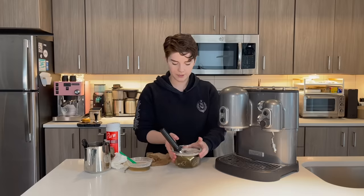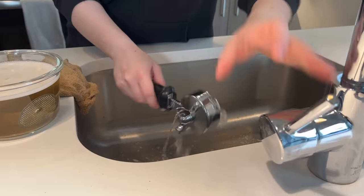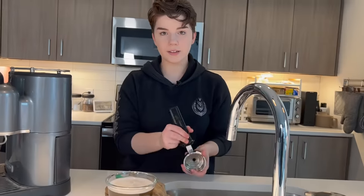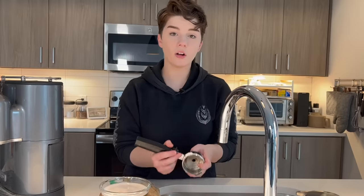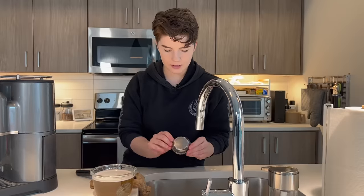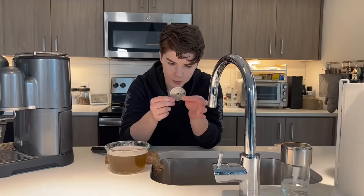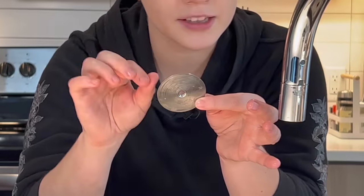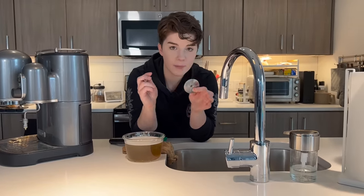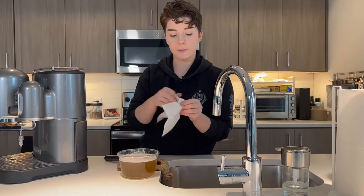Now that we've let all of our friends have a nice long soak, let's see what progress we've made. Our portafilter, which was super nasty inside — that's looking significantly better. There's a little bit of scrubbing that needs to be done. I'm going to let this continue to soak in a fresh batch of Puro. Next up, our portafilter basket looks pretty great — I don't see any tarnishing or residue left on it, and all of the little holes in the basket are completely clear, so there won't be any blockages. The screen still has some blockages — there are still some points where light's not able to pass through, where that deep sediment is stuck. I'm going to try to poke them out, but color-wise, there's no tarnishing, no built-up residue.